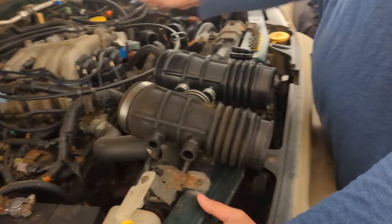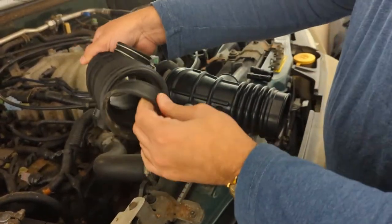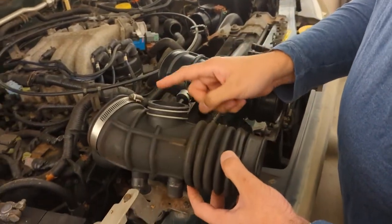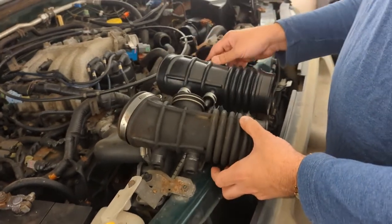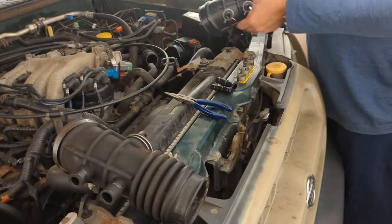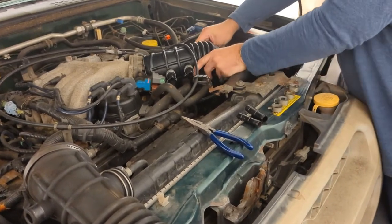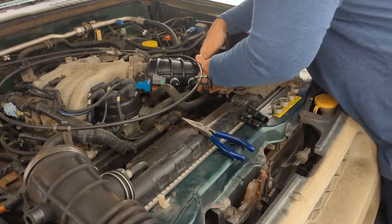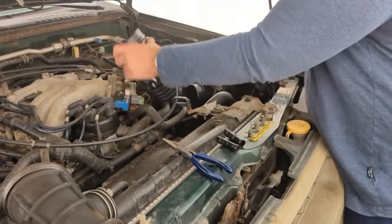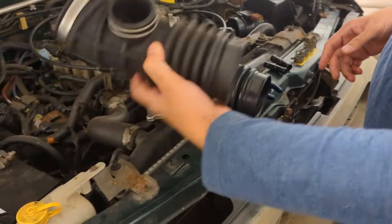Just to finish up the intake install over here — really an intake replacement. This is the old part; it's a new part from Amazon. I was replacing this because it's an accordion, so I'm going to change this. This is my old worm drive clamp — I have to transfer this over. I have a clamp over here I believe is for the secondary air injection — I have to transfer that over as well. But with anything you get from Amazon, you want to test this out. So I'm going to stick this on over here just to ensure this fits. That feels good — just going to install a couple of hoses. Looks good to me.